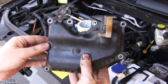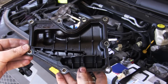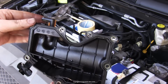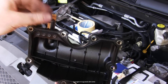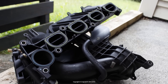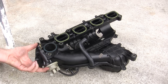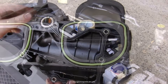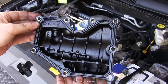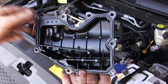Here's the oil separator assembly — it has plastic baffles built into it, intended to remove actual oil from the vapors and just let moist air through and up into the PCV valve. Ford updated the design of this a few times, along with revising the intake manifold itself, at least on the Mondeo. If you're replacing the manifold for any reason — likely the flaps, which you may know about from my other video — you should also replace this separator with a new one, along with the valve and hose at the same time, as they're really all just one assembly in effect.